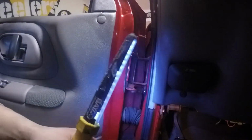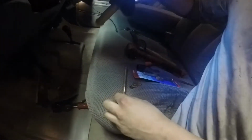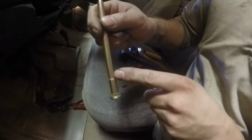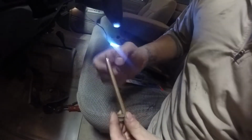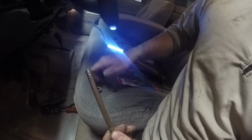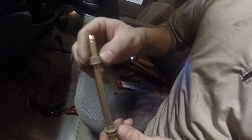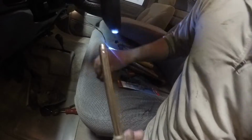I got those washers off. I'm going to take off this top one first and have the bottom one just sit in there. Here's the hardware. Here's a new pin. Here's the new bushings. There are 2 different size bushings, because if you can see this, it bevels up, and it's a little thicker down here than it is up here. So we've got to see what the orientation is on the actual truck, but I think this one's top down, and then this one's bottom up. But don't quote me, we'll find out. It'll sit somewhere like that, and then we'll throw this lock key or washer key down to where it hits this ridge right here. And that's what we're going to be doing.